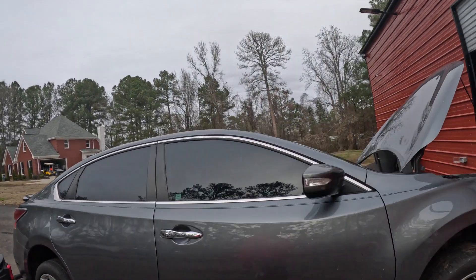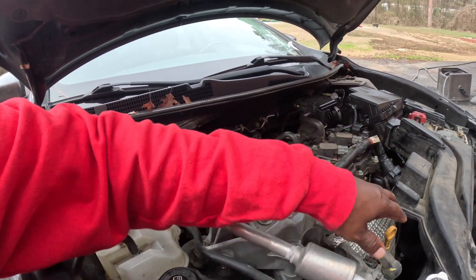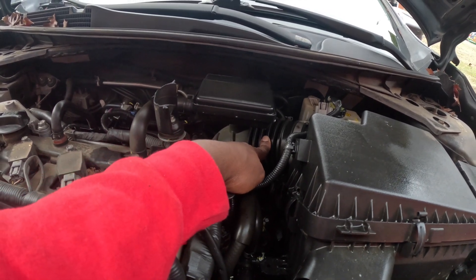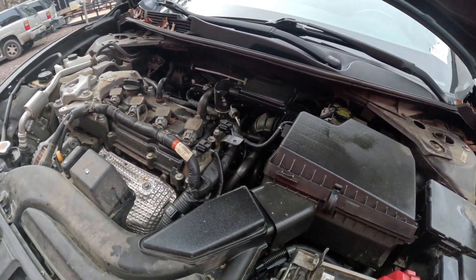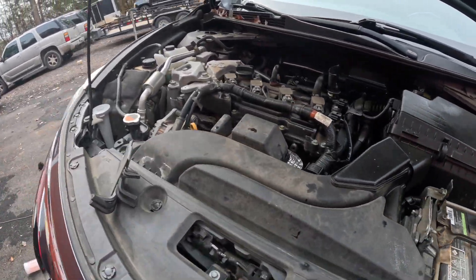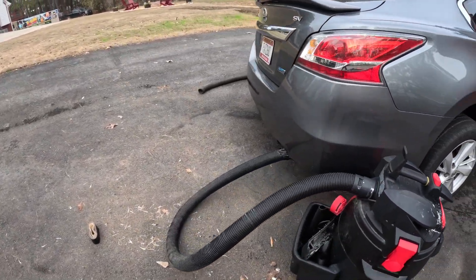So we know it does not have an exhaust leak. It's the unprofessional back with you — to let you know how to determine if you have an exhaust leak. The first things to do if you have emission codes popping up: you want to spray it all down, all over the intake, all over the exhaust manifold, the cat, even the filters and all that. Because a lot of times you have a little crack just in your boot, and that'll have you thinking you need to replace the O2 sensors and all that — but that ain't what it is, it's just a crack. Especially like I said, north cars you see that a lot. This is something to try before you start spending a lot of money. It's easy to do — just a wet/dry vac, some duct tape, and a water and soap solution.